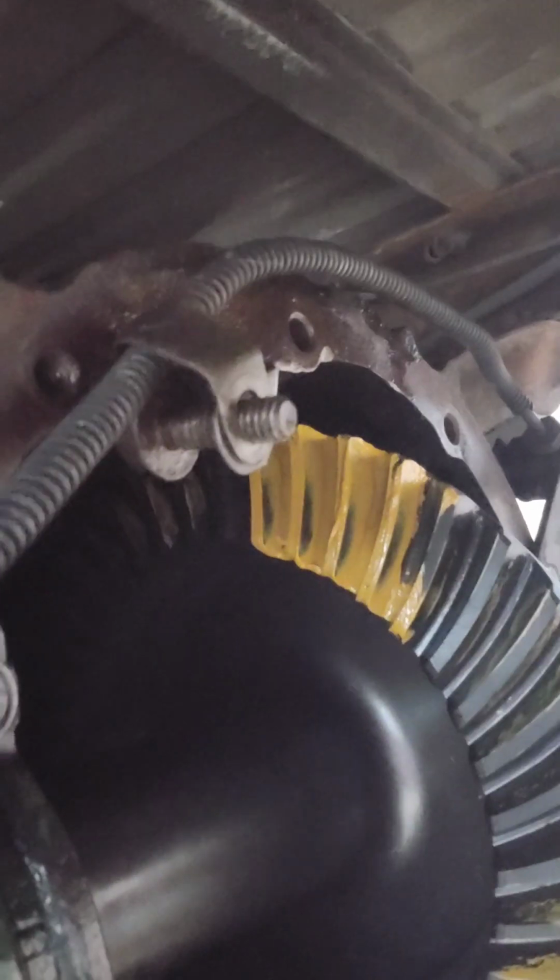But anyway, I'm gonna take this thing apart, change the shims a little bit, take the pinion down again just a little bit, just to get it a little more in the center. I think it needs to be a little bit more in the center, and then I'll have to adjust my side to side on it. The thing that sucks is I think I got the perfect amount of tension with the shims on the spacer. That's kind of what sucks. But I'm gonna check this thing out, and again, I'll let y'all see it, see what you think. Anyway, until the next one.